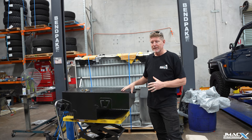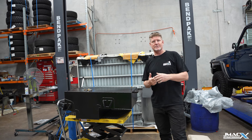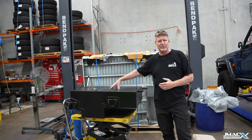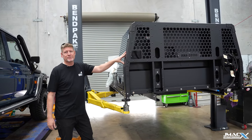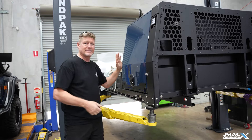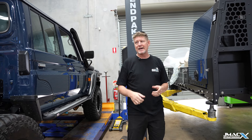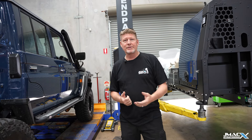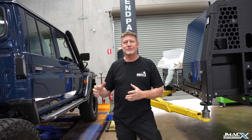That gives us the 185 and the 160, so about 300 liters of fuel. This has been a big one — even for my own 6x6 I wanted more fuel for more distance, so that 300 liters was important. This specific tank is designed for the Boss tray, which is over here. It's a Boss premium tray with a small canopy — fridge on one side. That tray combination on this vehicle, with 300 liters of fuel, makes it a really well set-out vehicle for remote travel — whether you're in the middle of Australia, Africa, Kenya, wherever — it gives you that great fuel range option.